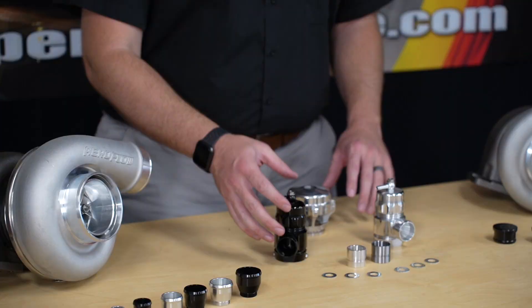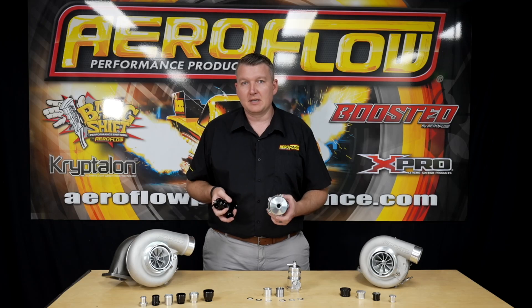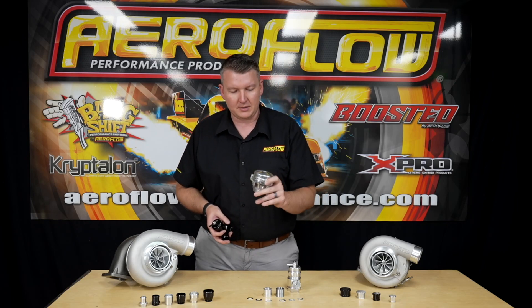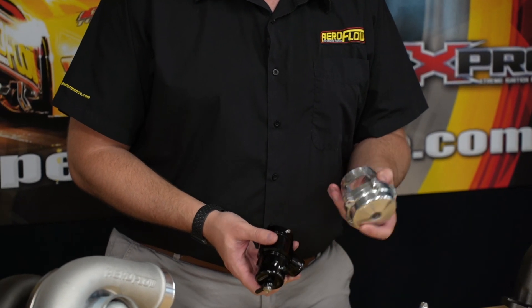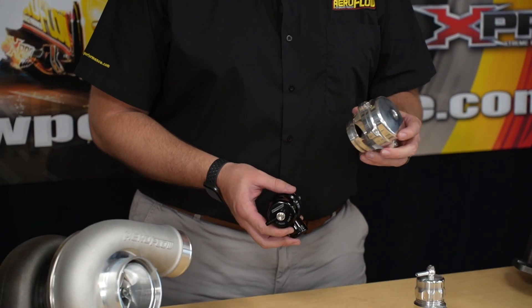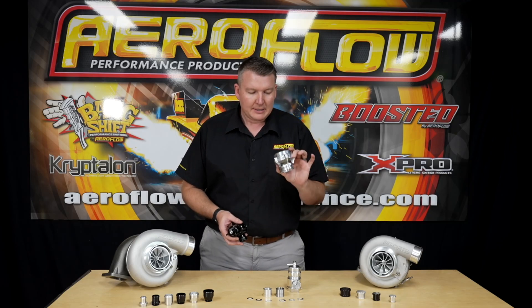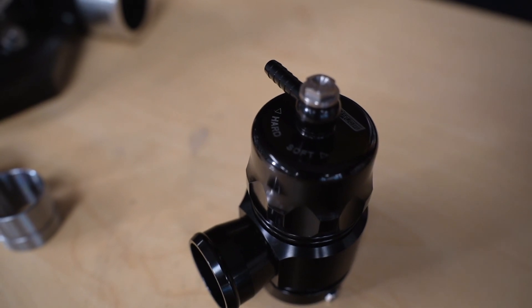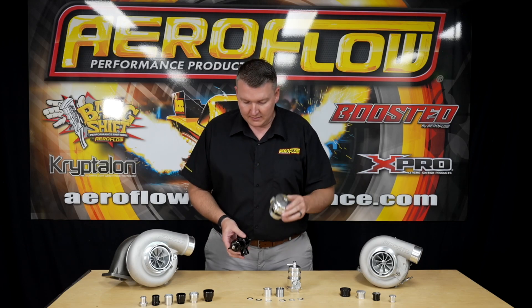When I say compact, we're talking in regards to the 38mm diameter of this one, as opposed to the 50mm bore of our traditional blower valve that we've had for quite a while. This is just an early prototype that we had, but as you can see, the physical diameter, the physical space that that takes up — what you can mount that to when it comes to fitting it onto a smaller diameter pipe — it's quite tricky to weld a bung on. Also, your only option is to vent atmospheric with this style. There is a return one, but it's not as efficient, so most people will buy this external version.